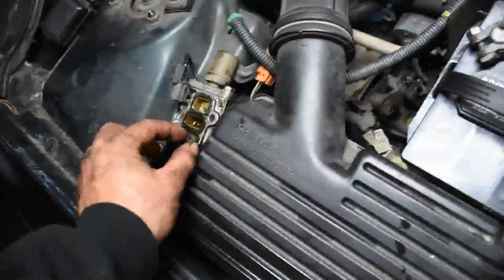And these gear wrench ratchet and wrenches, I'm gonna let you know right now they're not gonna work. I've got short ones here, but the heads are just too big, so you're not gonna be able to use a gear wrench on that. Just FYI. So anyways, I'm gonna go ahead and take out this old gasket and put the new one in, and we're just gonna go ahead and reinstall it.